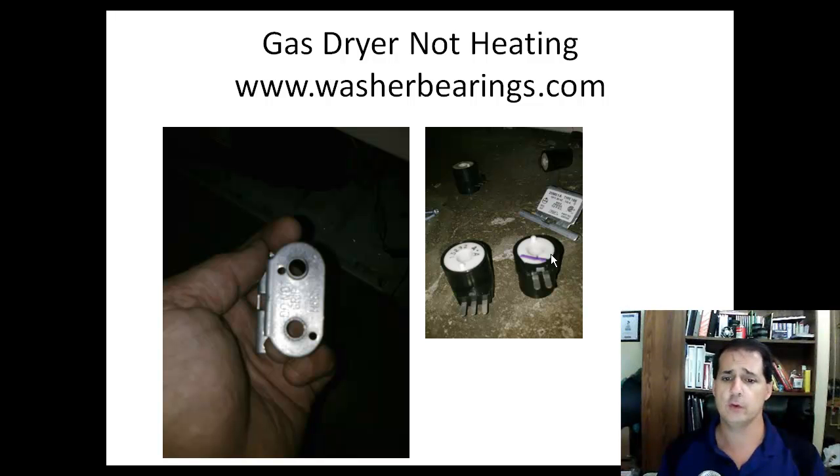Here is another picture of the two coils. You can see there are three terminals on one and two terminals on the other. I checked these with an ohmmeter — pin one, pin two, and pin three. I compared the original coils to the failed coils and did see a difference, which verified that it was the coils that are bad. You'll notice there are holes on this bracket and dimples on these coils, so theoretically you can't put the coils in backwards — they're keyed with those dimples. The terminals go away from the bracket, so when you put it back in you can't really mix these up without breaking off the dimples. So you don't have to worry about that.